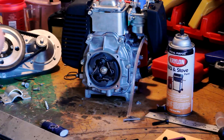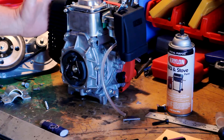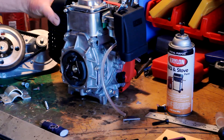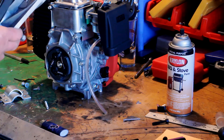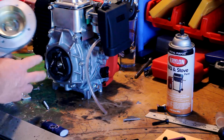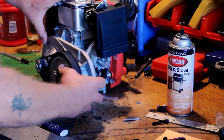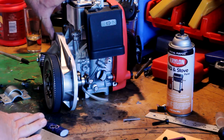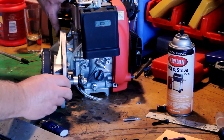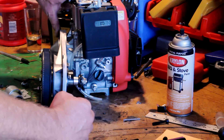We're ready to mount the transmission to the motor. Your motor is going to mount in your bike with the muffler and exhaust facing the front of the bike. This is the rear of the bike — your transmission, the T-belt transmission. Here is your clutch bell that fits over the clutch, mounting with the sprocket in the back underneath the carburetor. Here is our alignment point — the output sprocket from your transmission needs to be lined up with the sprocket on your rear wheel.